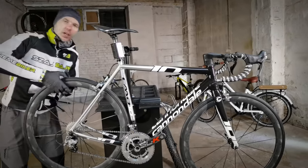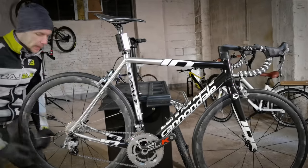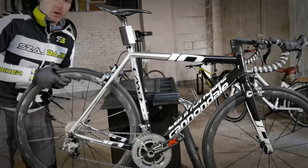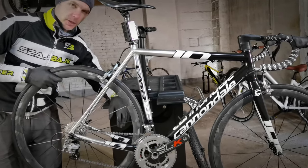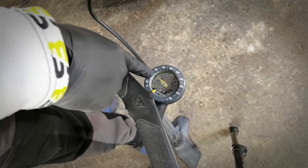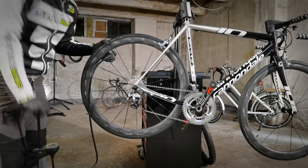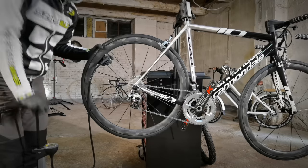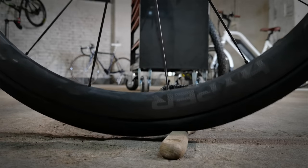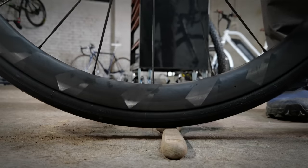For the road racing bike, checking pressure with your fingers doesn't make much sense because there's so little air volume in these tires. It might seem hard but will fail the curb test. At 60 psi it feels very hard but there's not enough air inside — way too little. My advice is to pump to 85 psi and then check how it works for your weight. This is the curb test.